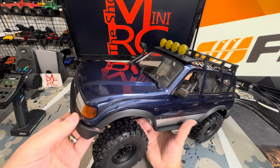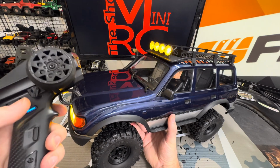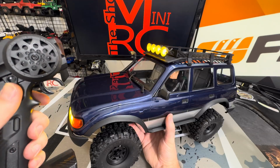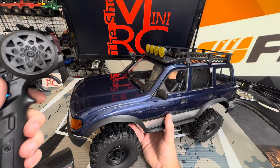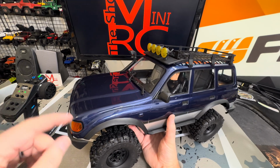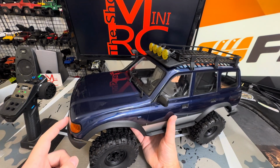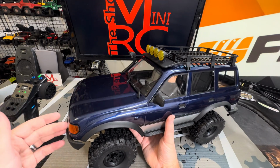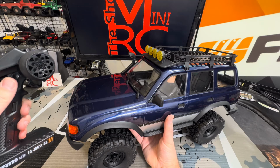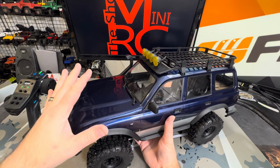So good to know. We're definitely going to do that because otherwise there's nothing that uses that intermediate, the center of that 3 position. Yeah, I don't know what that center position would be for because, again, nothing uses it. Oh, you know what you could do if you really wanted to? If this is on a separate light than the headlights, you could actually run this, which I think is part of the headlights, but you could run this into your daytime running lights and then you could have that turn on when you're halfway and then headlights. Anyway, I'm just glad we have the options.